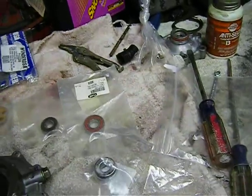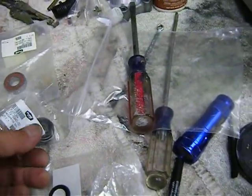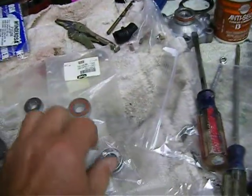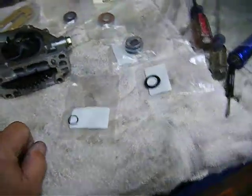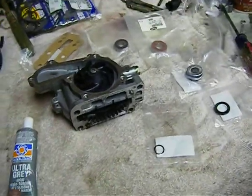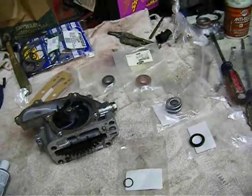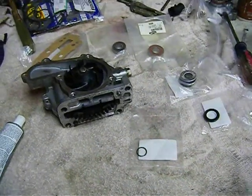To rebuild your water pump you need this little infinitesimal o-ring, a sealing plate, the actual water pump mechanical seal itself, and I suggest putting two new bearings in it. To do this it's pretty expensive — you can buy a used pump online but you don't know what you're going to get. It may be good, maybe not. This is important because if it fails so does your engine, so the seals and parts have to be done right.